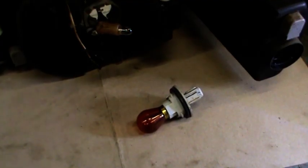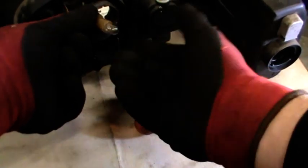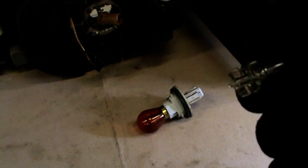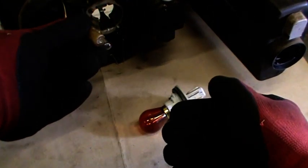Just wanted to show you, while the headlight is off, the other two bulbs in the assembly - the 5 watt sidelight bulb and the orange indicator bulb mentioned earlier. This sidelight is a capless bulb - you can hold this one by the glass; in fact it's the only way to handle it. It simply just pulls out of the housing. The shiny parts are the inside of the filament just protruding from the glass - no metal bottom at all. It can be put in either way, so it doesn't matter which direction it goes - it will still work. Just push it in. Capless type bulb.